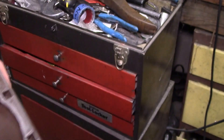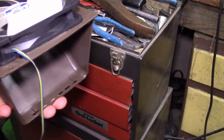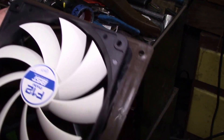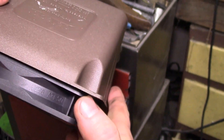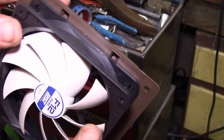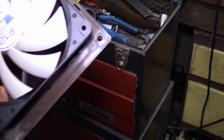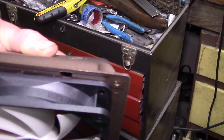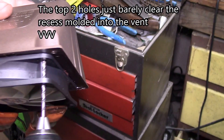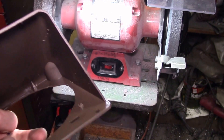You don't have to be perfect — just get enough opening so the fan airflow can go straight through. I get a clamp on it so I can slide things around and get it centered in the housing recess. I've got two clamps on, all four screw holes exposed, and you can see how those holes line up right on the edge. All four of them are drilled.